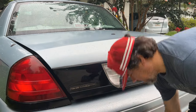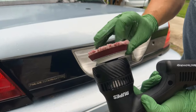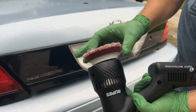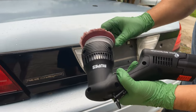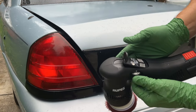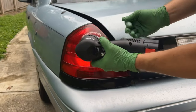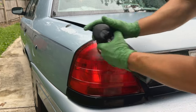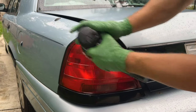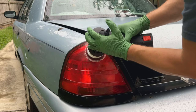It looks a little worse for wear but it'll be all right. Put those little drops of polish into the pad and kind of spread them around in there. I always like to wear gloves when doing this because you get polish all over you. You want to prime the fibers — that's what I'm doing here. I'll go on speed three or four for something like this. Before I turn it on I like to take it across the surface, just rubbing the polish across whether it's paint or in this case plastic.